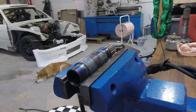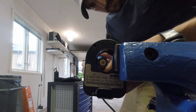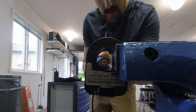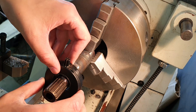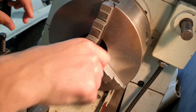Then we had to modify the steering angle sensor a bit. In order to fit over the 30mm tube, I just had to sand down the three alignment tabs protruding into the center. I really like this Bosch sensor — it's super small and light, and they can be continuously rotated so there's no risk of breaking them that way. From what I can tell, it's identical to the Bosch Motorsports sensor but you can find these on eBay for as low as 10 euros. I think I'll make a separate video about how to hook one of these up and configure it. After cleaning up the high spots of the welds, it slipped right on with a nice snug fit.